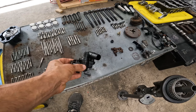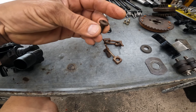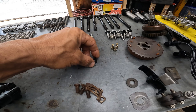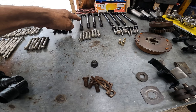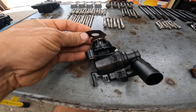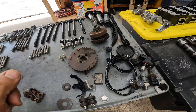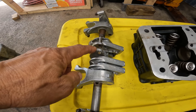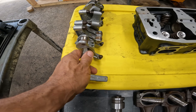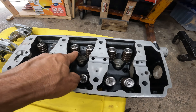This is stuck, we gotta take this apart and see what we got in there. The squirters — forget about it, completely rusty, they're shot. As for the ARP studs, I checked them all and there was one nut that is bad. Not using this. This is the piece that goes right here and it's completely rusty. The cam gear has seen better days. The sensors and rockers — it's missing the wheel and they're all stuck together, can't use this. It won't even turn, so this is garbage.